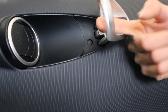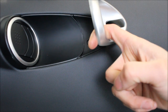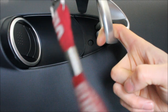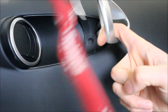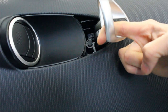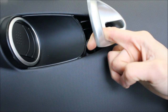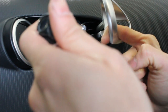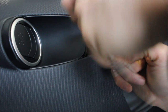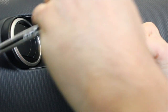On the inside of the door lever, if you pull this back, you can remove the panel inside. That'll expose another fastener — you can either use a Phillips or a 10mm wrench. It'll probably be easier with the wrench because you need to get an extension there. Be careful with extensions where there's a grip — keep the handle away because this is painted. You don't want that rubbing as you're loosening it because you'll take off the paint.